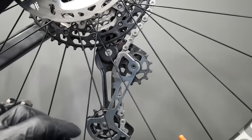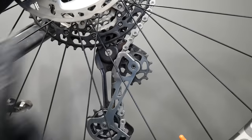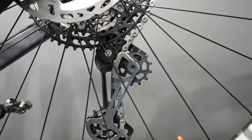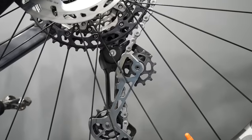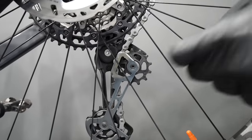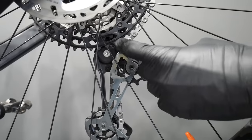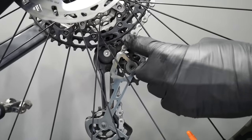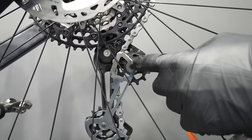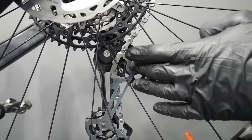You will be able to shift under load, shift in race, in sprinting — but this was wrong when the bike came to me. First, what are we talking about? We're talking about this movement here — the derailleur moving downwards a little bit towards the back and towards the cassette. This is essentially the distance between the guide pulley (the upper top pulley) and the cassette teeth on the lowest largest sprocket. On SRAM drivetrains I made a tutorial as well, with a special alignment tool, but here since Shimano has more options you need to know how to do this.